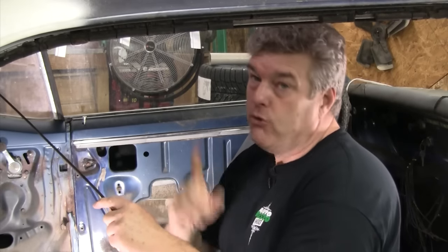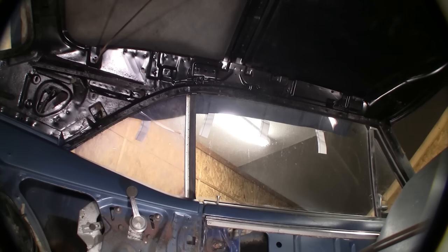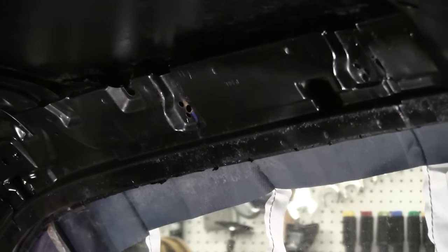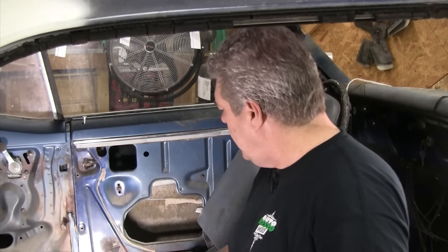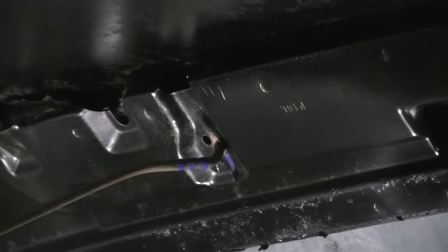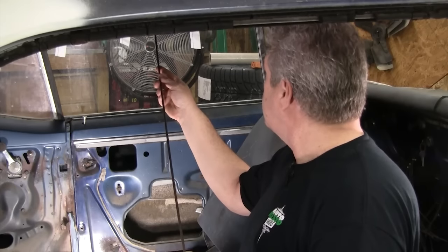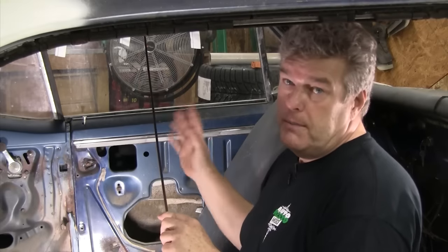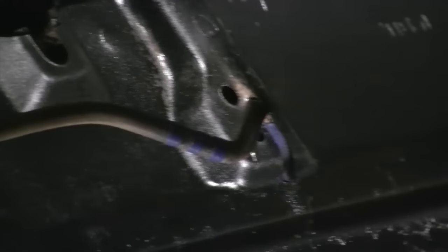You don't need to mark the other side except for hole position, because you can screw up — I did on my '69 Fairlane wagon where you put one of the bows in the wrong hole, and you'd be amazed at how much difference it makes in the position of the headliner. What I do a lot of times is mark the bows with a piece of tape so I can still see it after I've put the black down. I've also marked the body with an awl so I know this is bow position three — three lines of tape. So when I go back in and put my bows back in the car with the headliner, I'll know where it goes. We'll start putting the headliner in and show you how to install a GM headliner in a Camaro or Firebird.